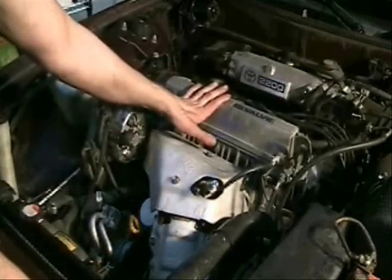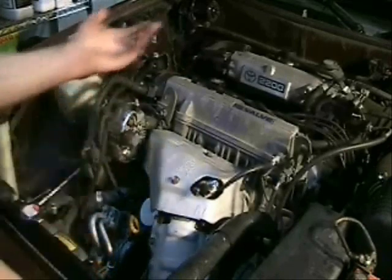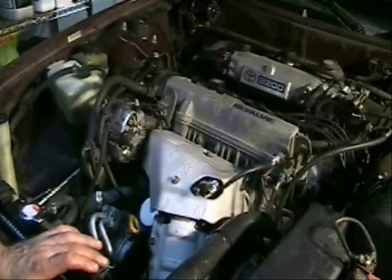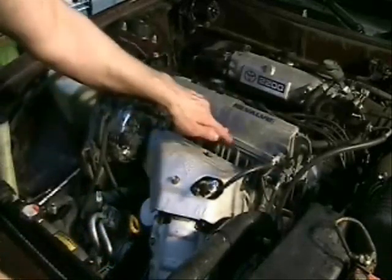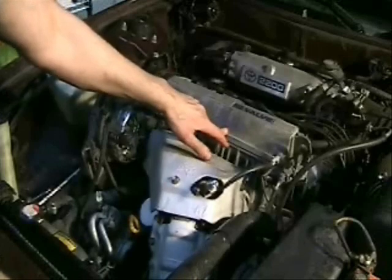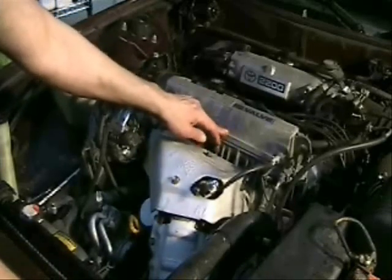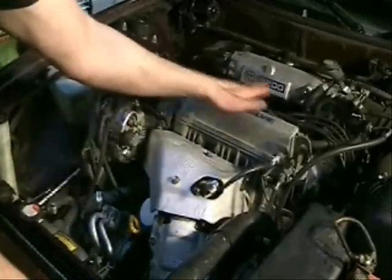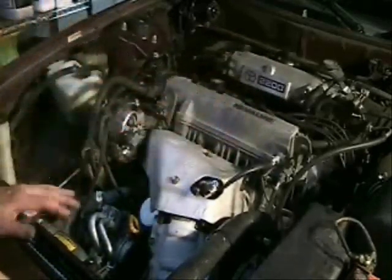You need to use some judgment. Right now every other indication is that the engine is in good shape, and it may be that this junkyard engine has half the miles of the original. I'm going to go off the data. But I'm going to bring this up with the owner to negotiate a better price, and I'm going to insist on doing a field compression test because I'm a little concerned about the junkyard situation.